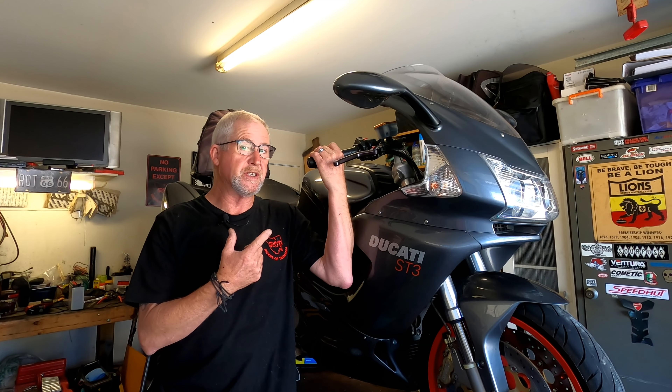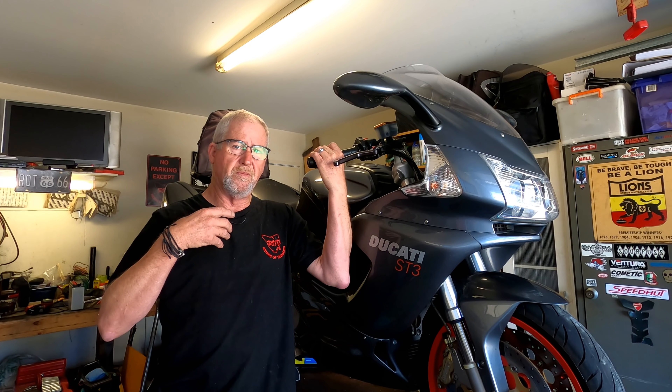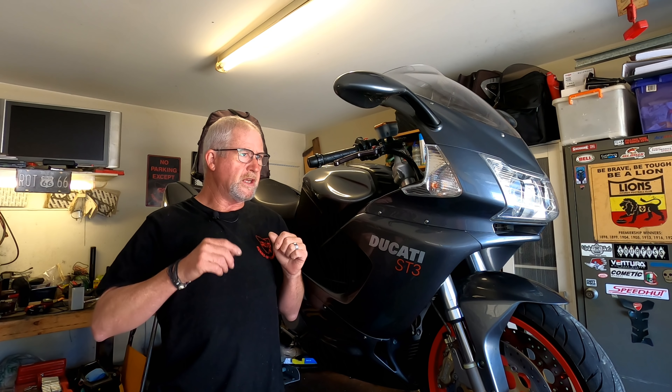It felt a little bit vague in a few areas. The bike trams very dramatically - if there's the slightest deviation in the road or a line in the bitumen, it will track it, it'll follow it. It'll even do it on painted double white lines. It's like if you've ever ridden a bike that's got no fork oil in it - that kind of feel - and would shudder up through even under medium braking. I've already checked the steering stem bearings, they're up to tension and there doesn't feel like there's any play in there, so I'm reasonably comfortable it's not the steering stem bearings.